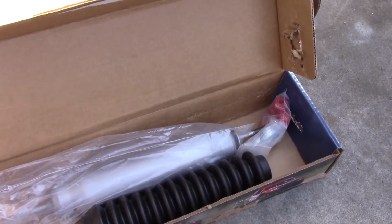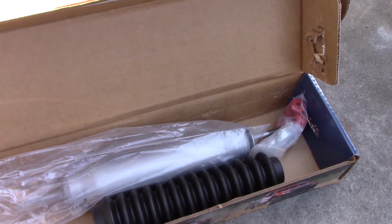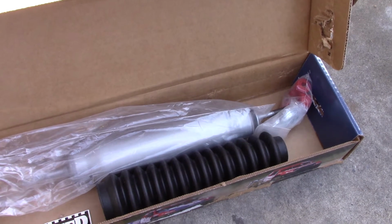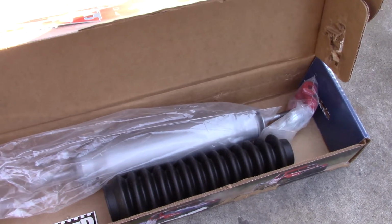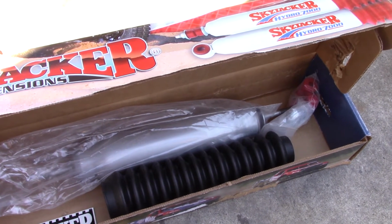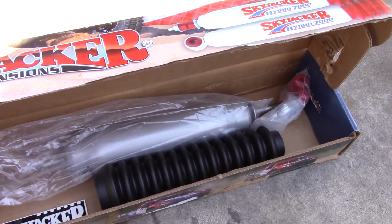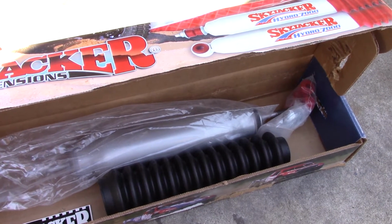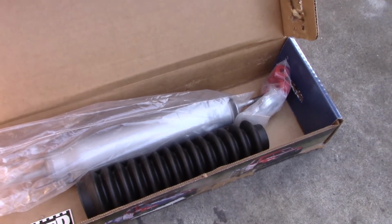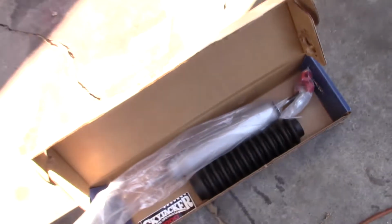And if you're going to go with a single steering stabilizer that is nitrogen filled, then it's pointless, because it acts like a shock and it wants to push one way. So what happens is it makes your car pull to the left or pull to the right, depending on how you have it set up. Because it's under pressure like a shock, it pushes. So you don't want that in a steering stabilizer. You want it to be neutral. So, Fox does actually make a really expensive steering stabilizer called the ATS, which is not under that kind of charge, but let me show you real quick.